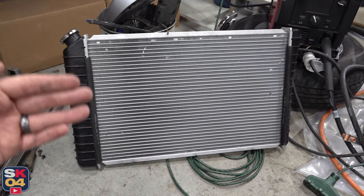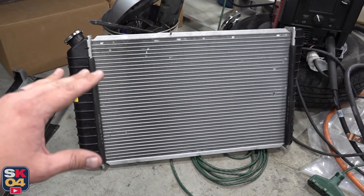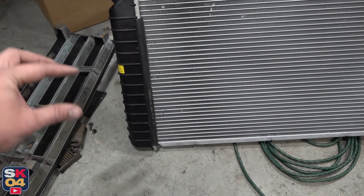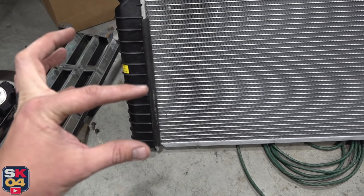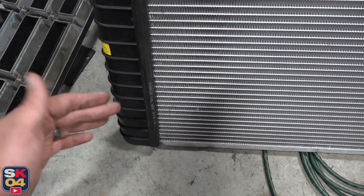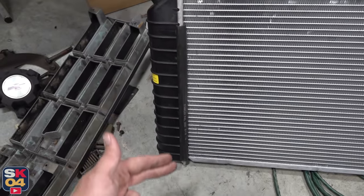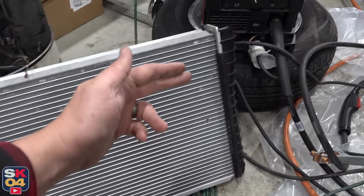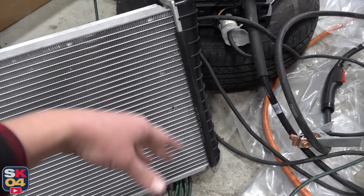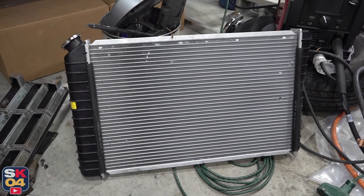On the back of the radiator where it sits up against the condenser — being that I angled the condenser as far forward as I did — there's a little bit of space in between the two, but towards the bottom there's actually a little bracket on the condenser that holds the pipes in place so they don't move around, and there's two screws that come a little close to this area. It's not touching, but just to safeguard, I actually took some 3/8 fuel hose and split it down the middle, cut two pieces, and it fit perfect — it kind of tucks into this edge of the radiator and wraps in over there. It's just me being a little bit paranoid so we have even more insulation going on.